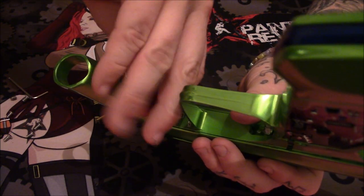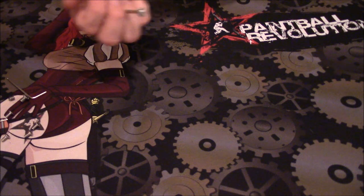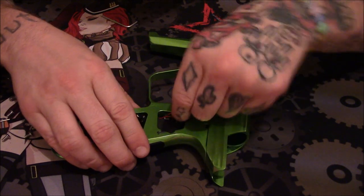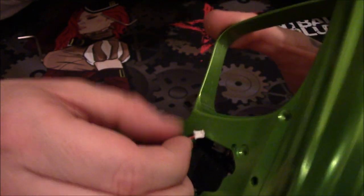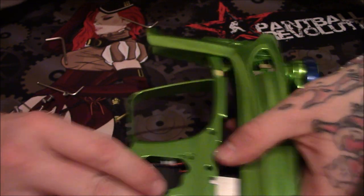Before you decide to just rip this off, you've got to be very careful — the solenoid is still connected. What I like to do is get close to where the solenoid is connected and gently pull it out — and I mean gently. Don't grab the wires too far back and pull because you're actually going to take it out of the housing and then you're going to be having some serious fun. All you do is gently pull it apart.